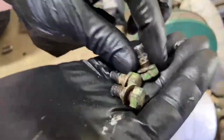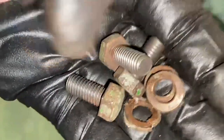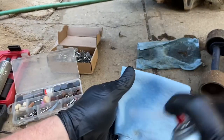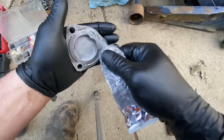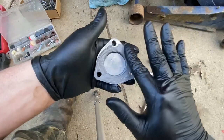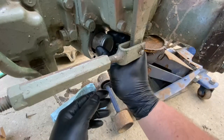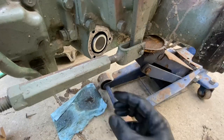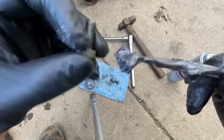The three bolts from the cap get cleaned up on the wire wheel. Before we put the bolts in we're going to clean the surface with some brake parts cleaner and a brand new rag. We have some Permatex UltraGrey gasket maker. Slip the open end of the filter in first — the screened end goes toward the cap side, open end toward the oil pickup side. We're also going to put anti-seize lubricant on each bolt so they don't freeze up in there.